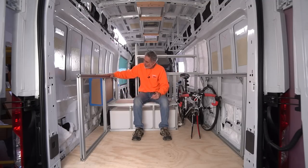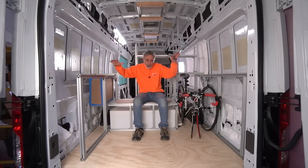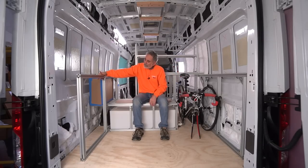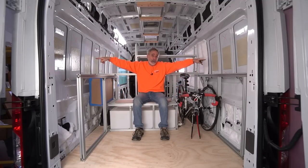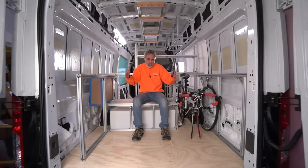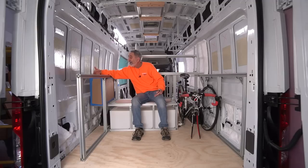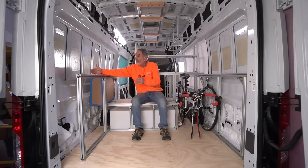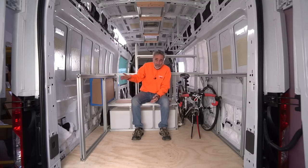Typically these bed frames, we push them against the outside walls of the van, then span with our beams to hold the mattress. Because these Ford vans, they're narrow at the floor, then they come up and boost out in the window wells. I thought, let me pull these frames inboard and gain some space on this side of them, because now it opens up more possibilities - as opposed to pushing it against the wall and wasting that space, just stuffing it with insulation.